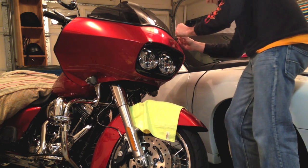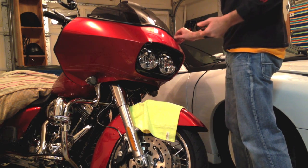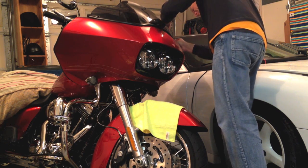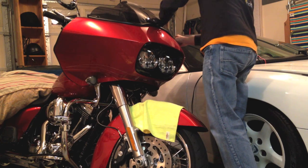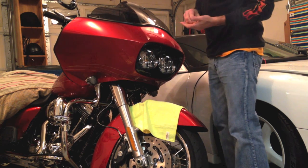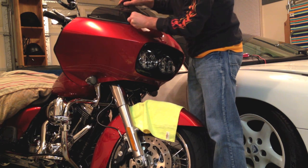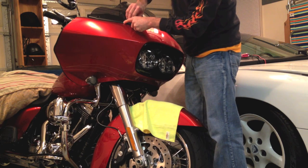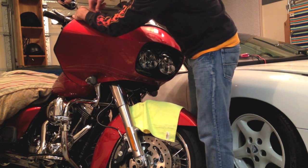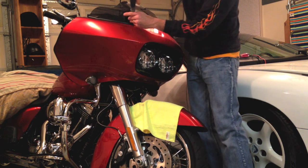Grommets in the fairing, while you had it off, or before you put it on to this point, you might want to, well, you can see behind them, make sure that you've got them elongated again, because they have kind of a squish, a squat type screw down when you tighten them. So while you have the fairing off, be a good time to insert a screw from the back side of them and pull them back out to extend them if you need to.